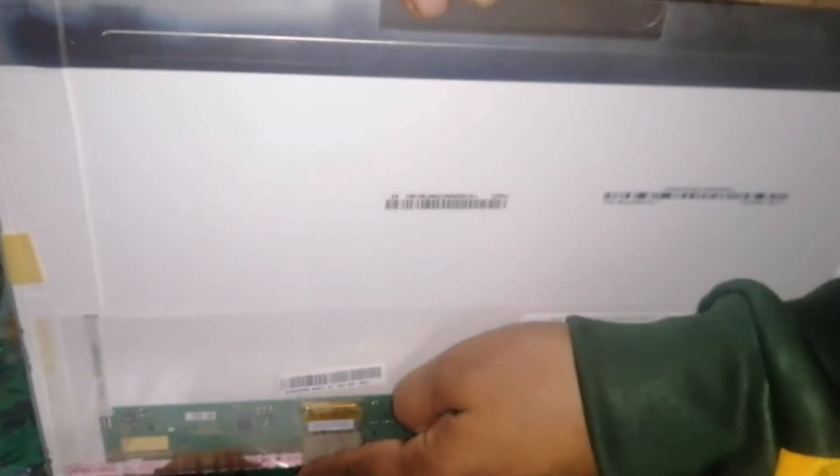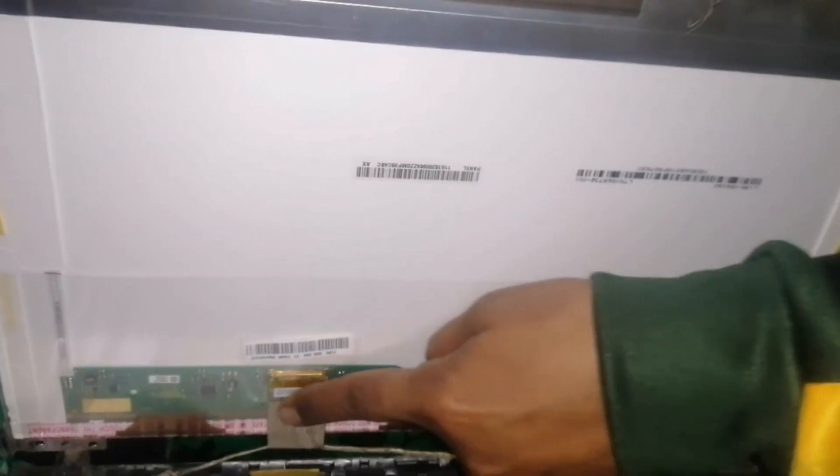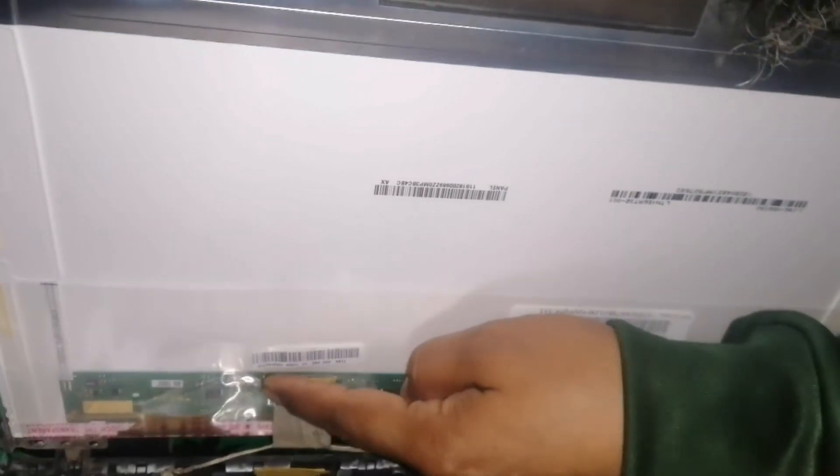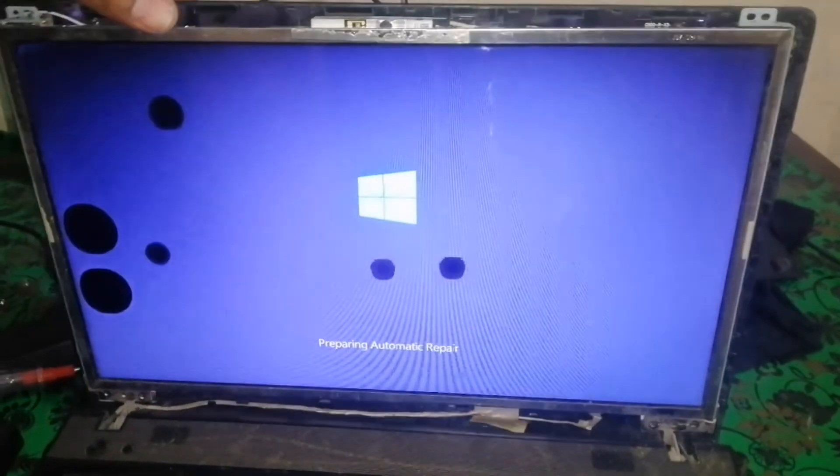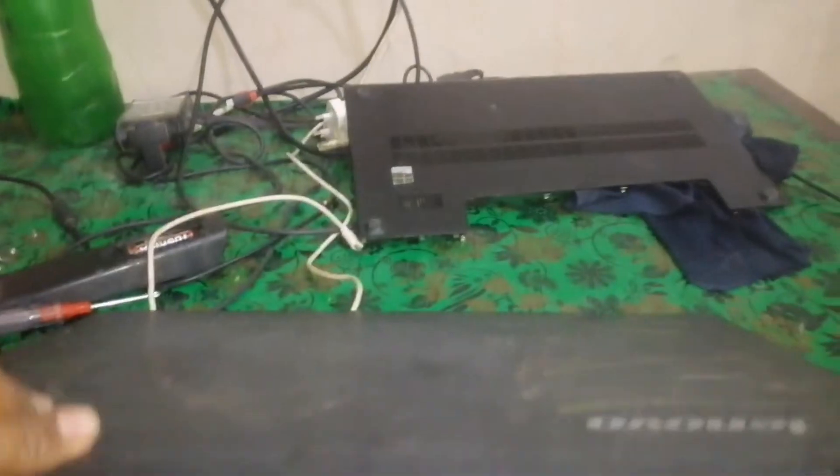You can see on the back side the connection of the strip to the LCD. Here is the problem — just press it if there is a loose connection, and try it on the laptop once again to check if there is any flickering. See, now the LCD is working very quite well.